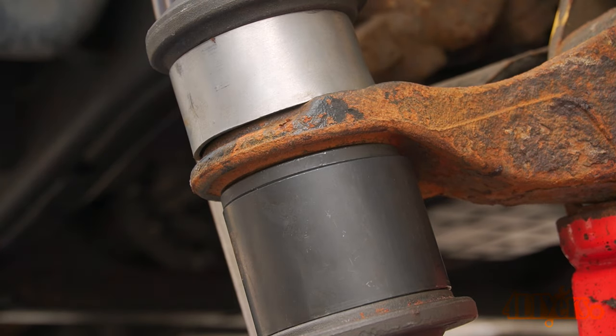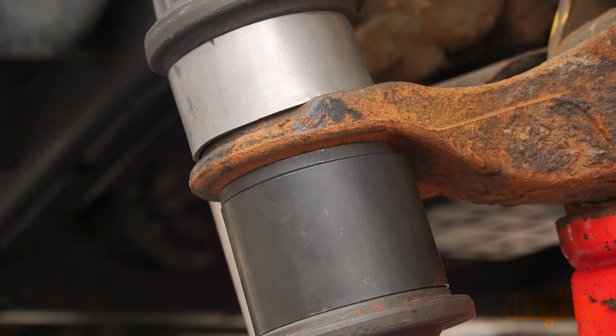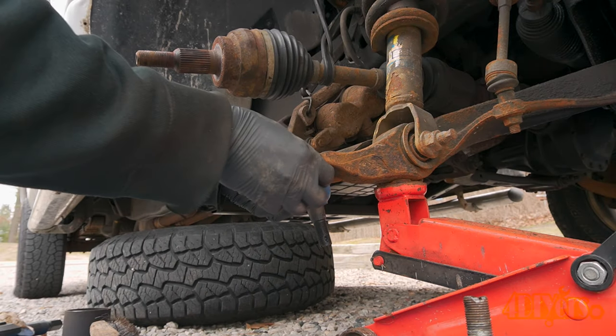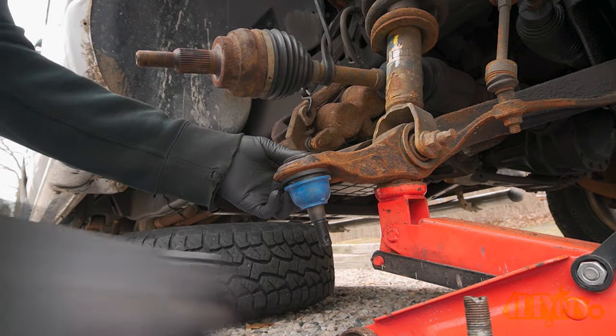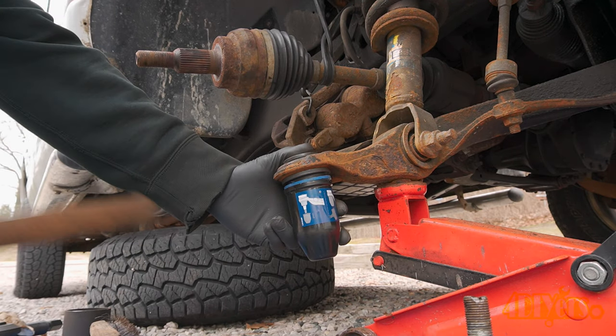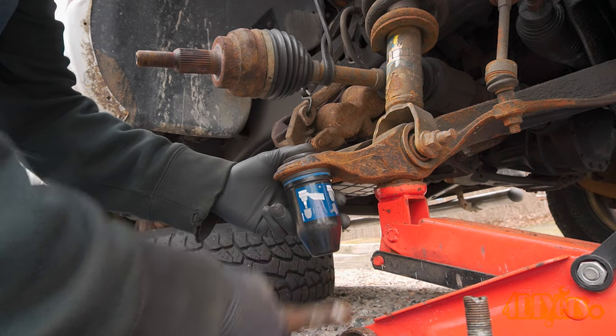As a close up, here you can see it slowly being pushed into place. That outer lip needs to be tight against the control arm. The next step is installing the boot to protect the joint. This particular brand of joint does come with an installation cup for the boot. Others can have the sleeves from your ball joint press used, or you may be required to use a large socket.